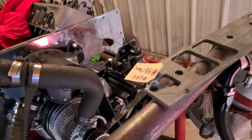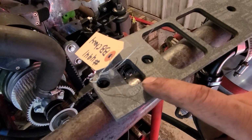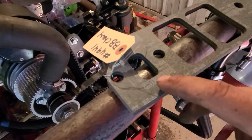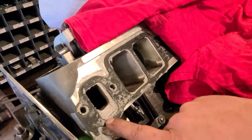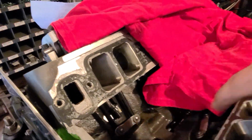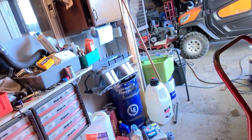So what I want to show you here is what we eventually found out for sure was the intake gaskets that I've got from Alky Digger here. They're a little bit thicker. Not really going to help the situation to line the ports up, but the coolant passage is a lot smaller than what we had here. So again, letting that intake base ride up here in this upper area, coolant was going under and then coming out into the valley there. We'll get this all cleaned up, put that on there, get the intake sat back on, the blower, and everything else.